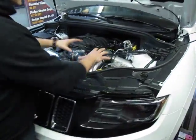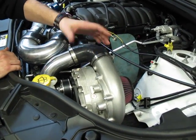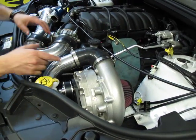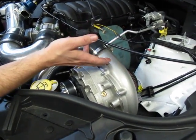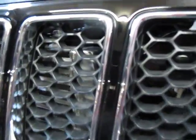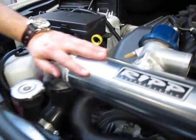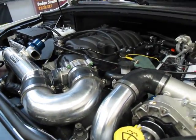So essentially, you're used to looking at that air box — that's stock — but we put a supercharger in its place. The air filter is now located a little bit lower. The belt is spinning the supercharger, which pressurizes the air in the compressor itself and brings it straight down into the intercooler piping. In the grill here, you have a front-mounted intercooler, which looks awesome and cools off the boosted air. That feeds right back up on the other side of the radiator into this boost pipe — 3.5-inch — boom, into the throttle body, and you're making a lot more power.